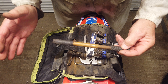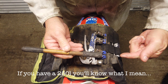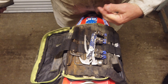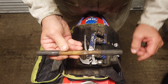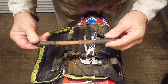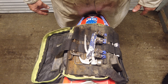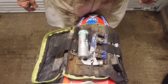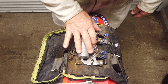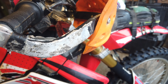This is what I call a dummy shaft. I only need to use it on the CRF because they're bloody awkward when putting the back wheel in. Getting the back wheel in is a hell of a job because one spacer will fall out, then the other one will fall out, and then you can't get the disc caliper in line. So what I do is slide this into the wheel with a spacer on either end, put the disc caliper on, line it all up, and then push the spindle through. If it's all lined up nicely, the spindle will push the dummy shaft out — it saves all that bloody swearing. This one's made from a bit of cane with tape on either end to make it roughly the right diameter. I have used a hose pipe in the past. It's a hell of a lot easier.